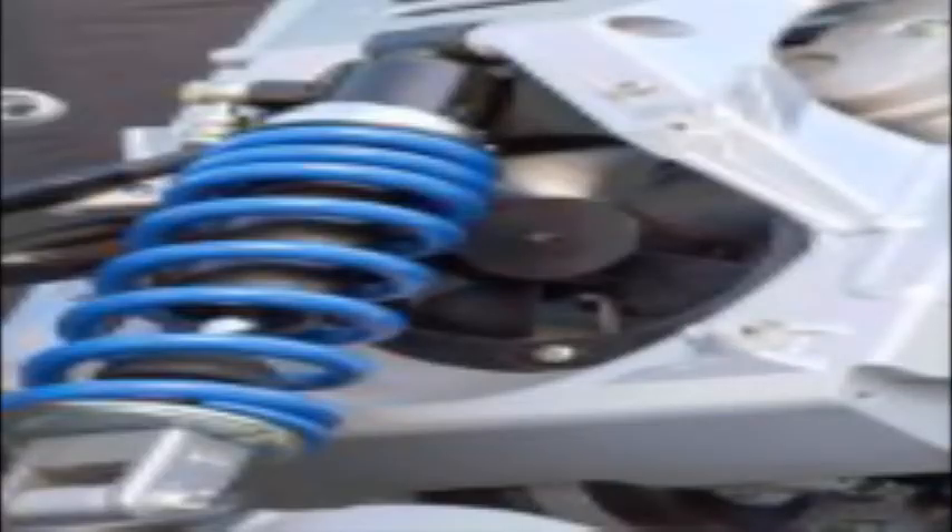The 5-speed transmission worked without any complaints, although we suffered from false neutrals until Buell technical staffers lowered our shift lever a few millimeters, allowing us to get a better push on the lever. Once that was done, changing gears up or down was a no-brainer. The new frame and suspension components make this the best-handling Buell ever. As for the brakes, we felt they were adequate but didn't possess quite as much absolute braking force as we'd expect from the huge brake rotor. The 375mm disc combined with the six-piston caliper gets the job done, but it isn't enough to come away in awe. Nevertheless, we were impressed with the modulation — braking pressure and force application was very linear and extremely easy to control. These are traits far more valuable on the street than on the track.